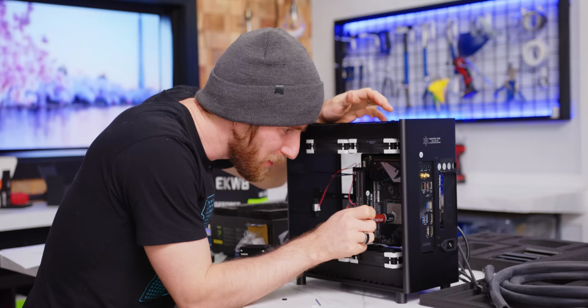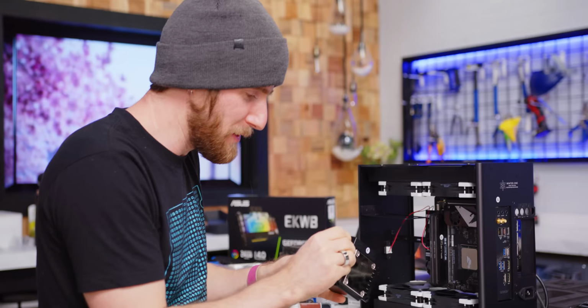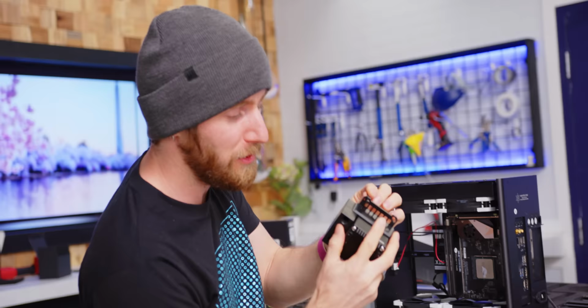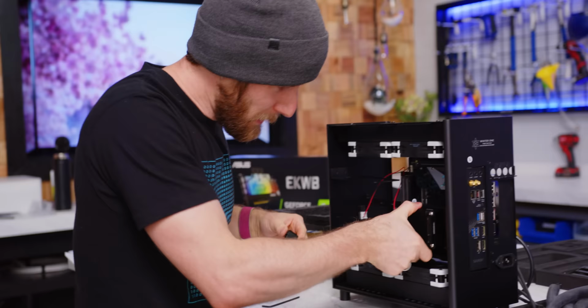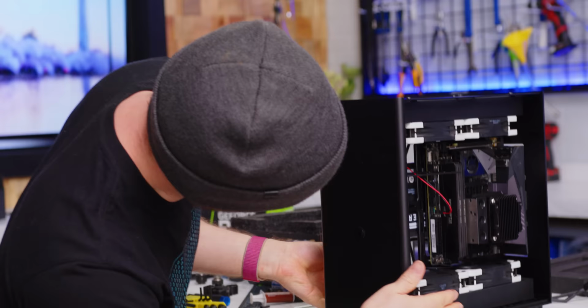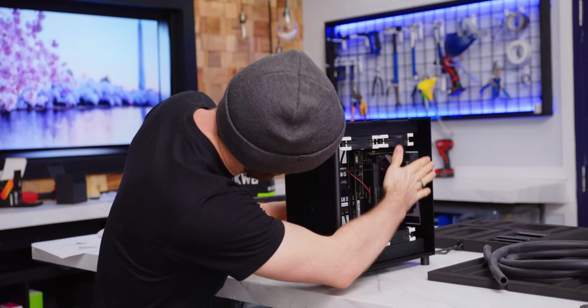I think we've got a solution. So let's put some thermal compound on here, and there are gonna be those of you who don't like it, but basically, it's 6-32 threading. We've got tons and tons of 6-32 bolts. So we threw a plastic washer on there and we're doing a hard mount. For better or for worse, it's on there. And holy crap, that is why we needed to use this low profile AIO solution.